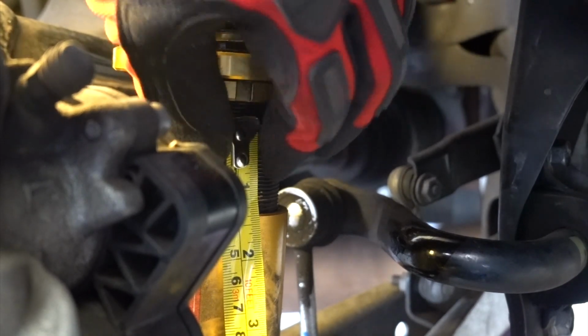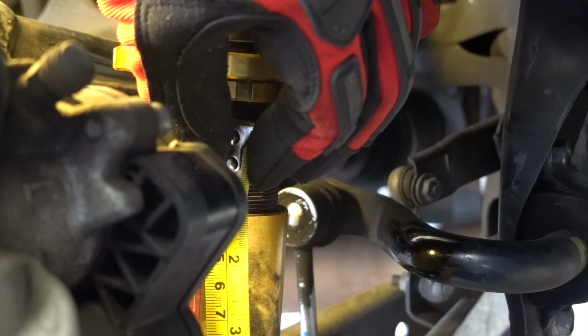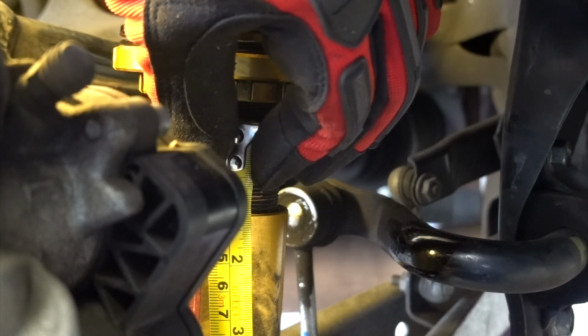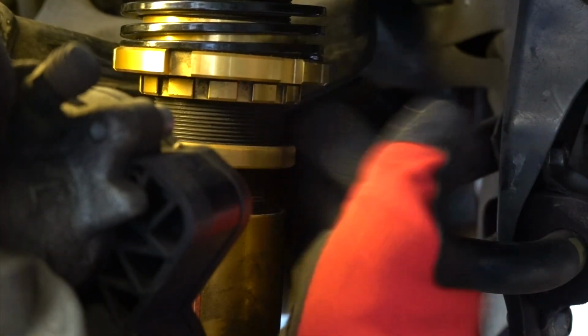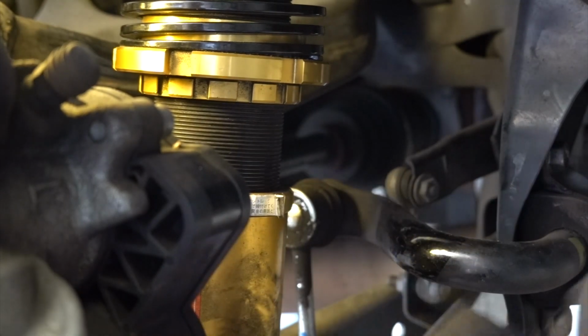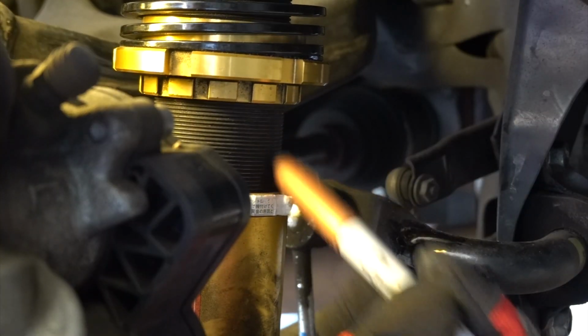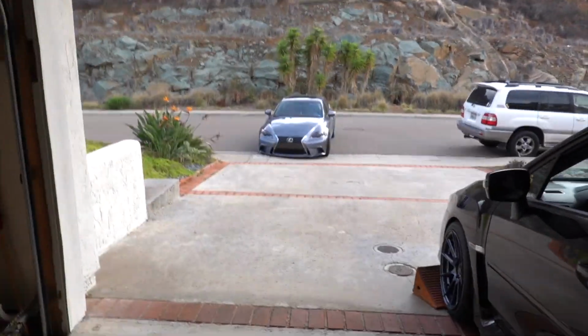Basically we're done. I'm going to start at the 1 inch. If we look towards the bottom of our strut housing, we're over 1/8 of an inch, just a couple ticks underneath 1/4 of an inch, but I think that's going to be fine. So what I like to do, before I button everything together, is get this down to where it won't shrink, not torqued down. I will adjust the other side. We'll measure the distance of the threads on this side and the next side after I adjust it, and then we'll button everything together.